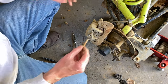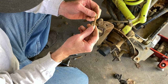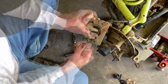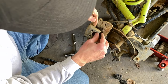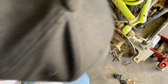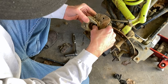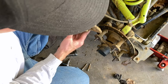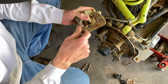I just got the caliper off, then I pulled these pins out — which are always nasty, at least the ones I've done before are kind of rusty. So I put them on the wire wheel and cleaned them up really good. This pad just kind of rotates out, and you can see it's worn way down on the side because this thing has been slipping without that little grommet in there. This side's still pretty good, but we'll go ahead and replace them. Next we'll get these on the wire wheel and clean them up nice and shiny, then compress this piston back into the caliper so that when we put our new thicker pads on there it will shut. Sometimes you can do it with your fingers; if not, you can put a C-clamp on there and push it back in.